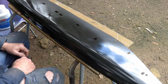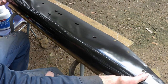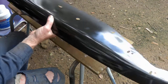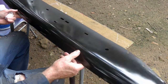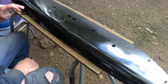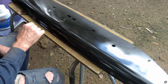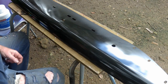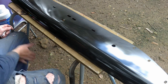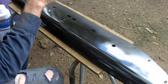This is the panel that goes under the radiator grill and mud guards. Mud guards come around here and bolt on around here. There are quite a few points where it attaches to the car, but the thing stopping me from getting it in with the guards in place are these two holes here — where the crank handle support fits inside the chrome surround. You've actually got to mount that in the chrome surround first.